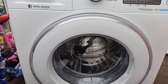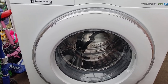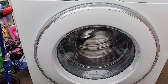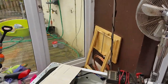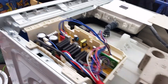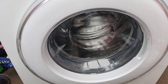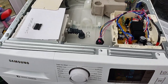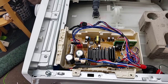Hopefully when it gets into its spin cycle in a moment — the price of the chips I should mention: they're only five dollars each, so it cost about ten pounds to fix the whole unit. And there we have it, all back up and working. Hope this video is useful to somebody out there. If you have a problem with one of these washing machines that isn't doing anything at all, I think it's either going to be dry joints or it's going to be that motor control chip.